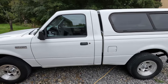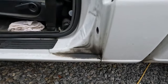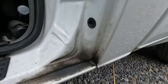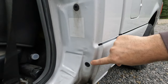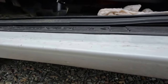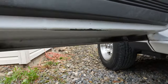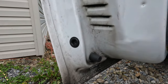The Ford Ranger has been oil undercoated every year that I've had it, and it was oil undercoated even before I had it. You can see here in the corner what happens - the oil kind of seeps through where these pieces overlap. This is actually one of the places that the oil is sprayed into the truck. The mechanic drills these holes out, puts a wand in there, and sprays that material into the body. All these Pennsylvania winters later, it has still kept that rocker panel from rusting. Same thing with the door - you can see there's some oil underneath the door there where it kind of drips out, but there is no rust. There's another one of those knockouts where the wand goes in to spray the oil.